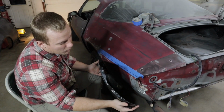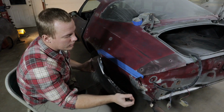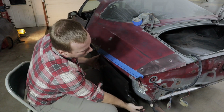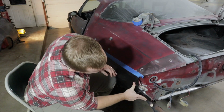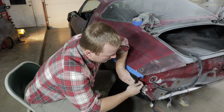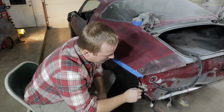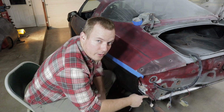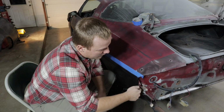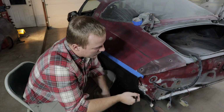Okay, so before I cut it all the way down here, I should make sure to check that the replacement lower quarter panel is actually stamped out to the exact same size as the original lower quarter panel. I noticed, whenever it's lined up against here, that the original quarter panel actually wraps around towards the back, and this one stops halfway in the middle. So I think what I'm going to do is cut the original quarter panel along the seam of where this would end up meeting it. Instead of undoing it from the spot welds up here, I'm just going to trace it out like I did up here and cut that, and it'll probably look better in the long run.